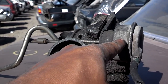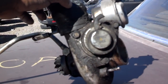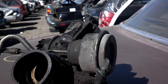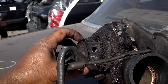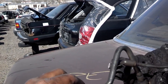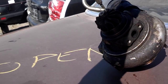On top of it, it has a wastegate actuator — you see the arm there and the actual actuator itself. On this side, you see the bypass or blow-off valve that's mounted to it as well. Other than that, you see a couple of vacuum tubes. Usually an exhaust flange is mounted here, so you don't see the exhaust turbine. There are a couple of lines: a coolant line used to cool it, a port for oil line intake, an oil line exhaust, and a coolant line exhaust.